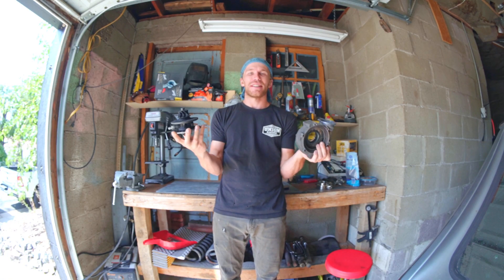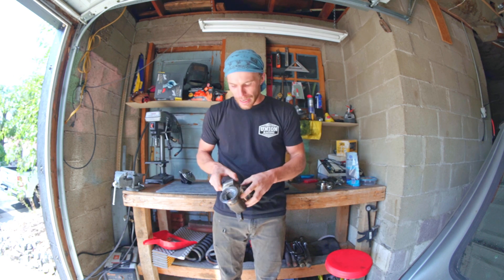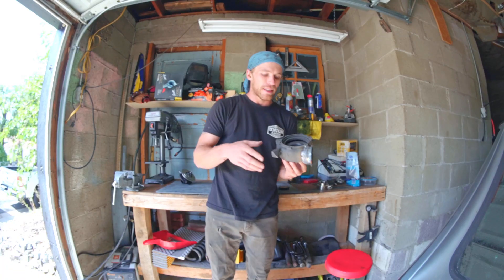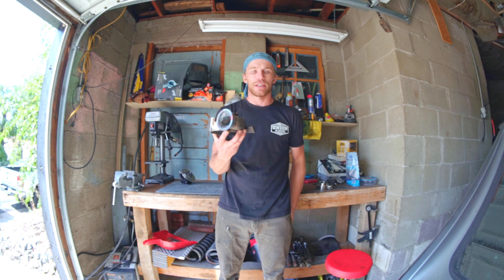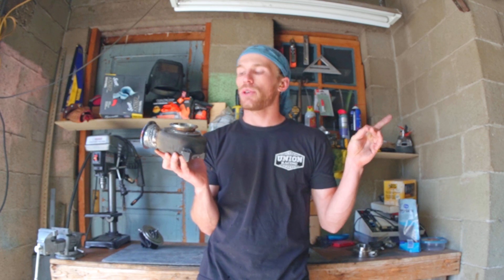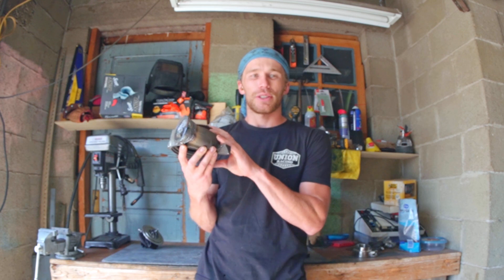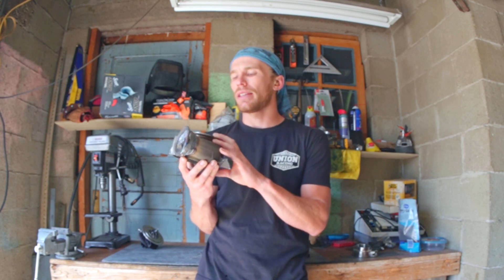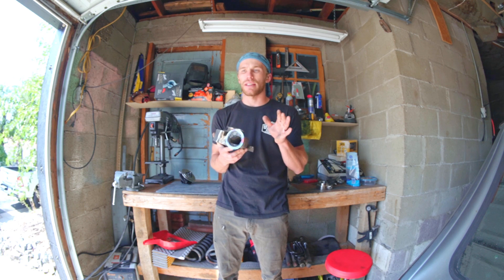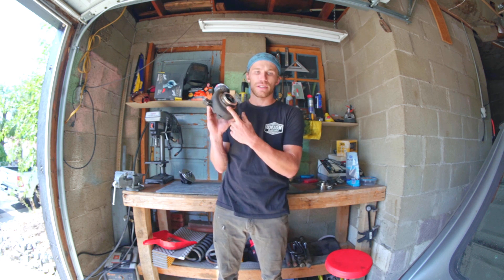These pieces I am holding are a GT22V — a Garrett 20-series variable geometry turbo. I had to do some conversions the way I got it; there was no way in hell it was going to go on the car as-is. Classic Ollie chops and hacks a turbo completely to fit the way he wants. The beautiful thing about using another 20-series — my other one was a 2052 — is it has the exact same oil in and out. So really all I have to do to adapt this turbo to my car is change how it mounts: basically the exhaust piping. I'll have to do a little fiddling to get the intake piping to work, but nothing bad. It's just a matter of fabbing up accessory attachment points.